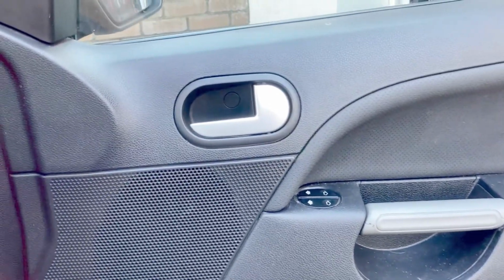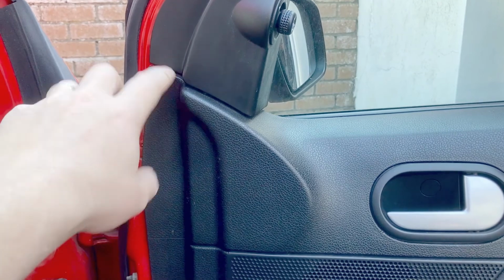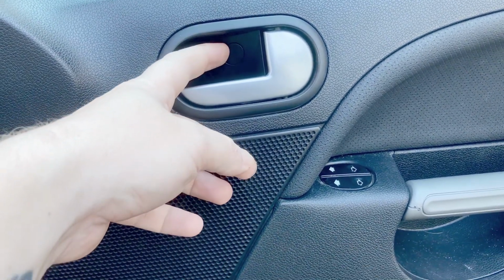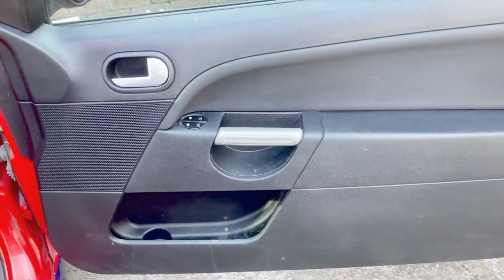So just looking around the door panel now and see what's involved in taking it off. I'm going to take all the mirror parts off first because you can see they're overlapping, so I don't know if there's any fastenings behind there. There's going to be one behind there. It's just a little plastic covering to come off. I can't see anything being into the switches, but they'll come out first. Can't see anything else around. There are a couple of bolts under there. So there, that's come out. Can't find the other one. It's there somewhere. 1, 2, there we go. So, gonna get on that next.